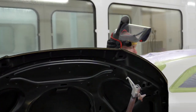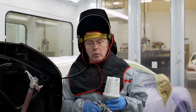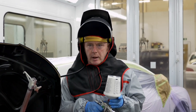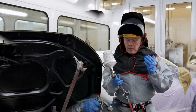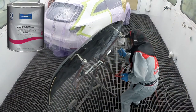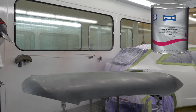I've mixed my wet on wet, the colour and the blender I need for the quarter panel and now I have everything I need to do the job in the cabin with me. All products are mixed as described in the TDS. Please ensure the base coat is activated or hardened. Before I start application of the wet on wet I had a few minor sand throughs to bare metal that I need to deal with. You'll remember I showed you the wipe and told you to place that in a plastic bag, seal it and use it again later — so that's what I've done. This new wet on wet is really nice to apply, has low viscosity and gives a nice smooth finish straight off the gun. I'm using a top coat gun with a 1.3 setup and I'm going to adjust the pressure to 1.5 bar inlet. With this material I can spray it in one to two coats, but my tip is to first spray a light coat followed by an even closed coat.